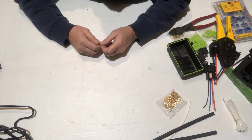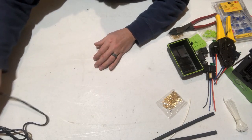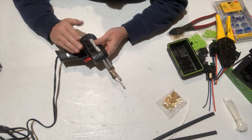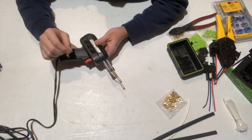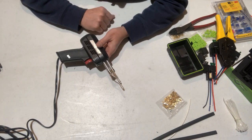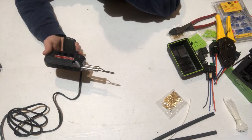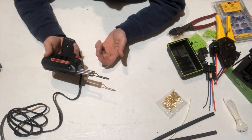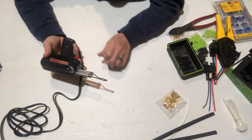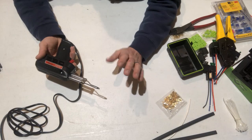As I said, if you're going to do a butt splice, I personally like to solder and heat shrink. This is the soldering gun I'll be using for parts of the project. It's pretty powerful — if you don't have a feel for it, you can burn a wire up pretty quick. They also make the pencil type, which can also be used for this project. This is a 140-watt gun, so you can get heat really fast. Soldering is what I prefer, though some people don't like it and some people do — it's your choice.